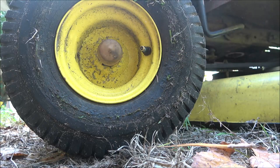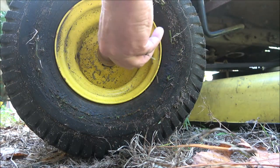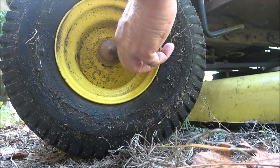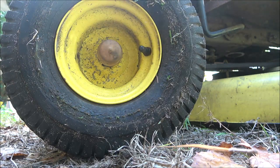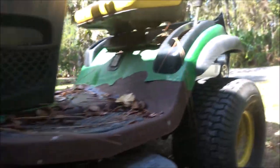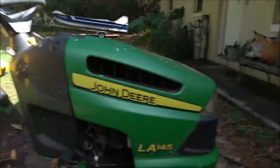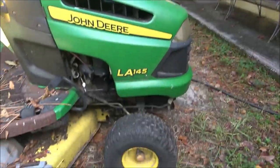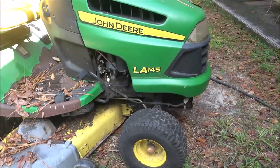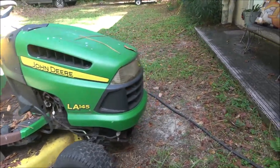all right, let me get my thing, tighten that up, but it is dry cracked really bad. That's never come out of there before like that, but it's just really dry cracked. All the tires are. I fixed the back one and this one, they all went flat, but they was leaking around the beads, so I just popped them off the beads and I put some grease around the rim and that worked.